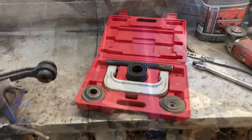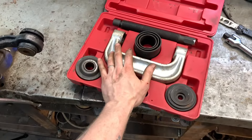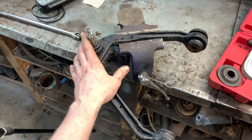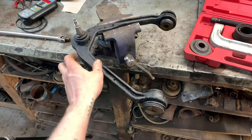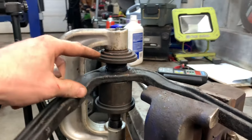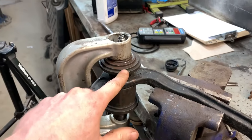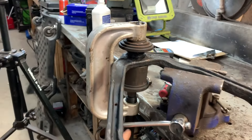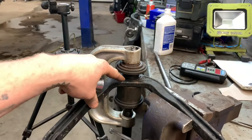Here's a ball joint service tool — it's basically a big C-clamp that presses ball joints in and out, also good for U-joints. I don't think you'd be able to do this job without it if you want to save your ball joint. I mean, if you had a big hydraulic press, yeah, but to remove and press it back in without destroying it, this is about the least expensive way to do it. I have the ball joint press set up here, took off the C-clip, and I've got it set up so the stud is free from the press. This plate is going to push the body of the ball joint down through the hollow, and I'll tighten the C-clamp threads — if it damages the ball joint, I'll replace it.